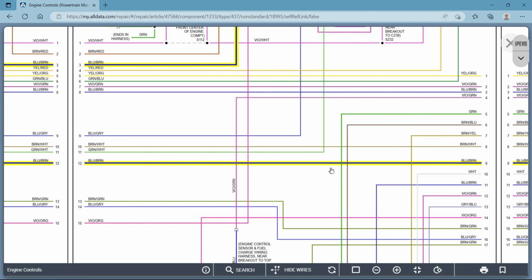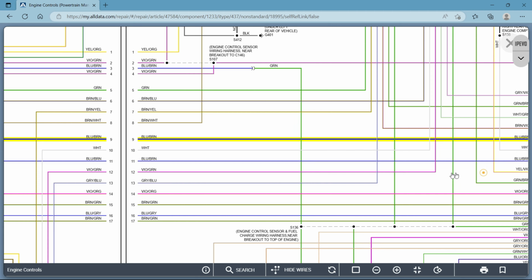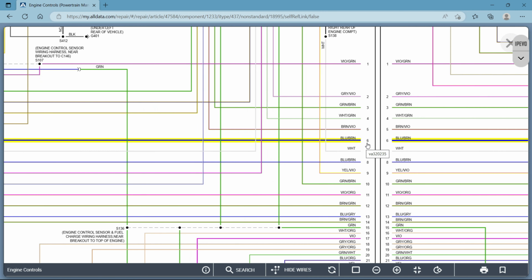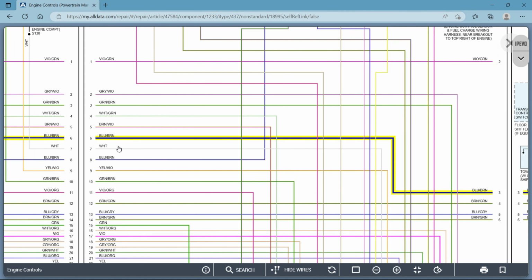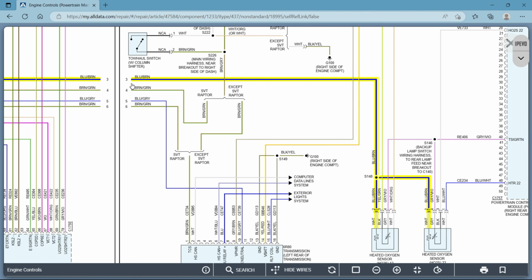So now if you follow that wire along to the right side of page 2, you'll notice there's still a number there, but you'll notice it's not number 12. That's fine. All you do is go to your next page in line and find your number 9. It corresponds with the number before. Same thing, scroll to that side of the page and you'll see it's number 6 and so on and so forth, okay? And by the time you get to your last page, so this is probably a 6-page thing, but nonetheless, you'll go from number 6 to a number 3. Now your last page, you go to number 3, and you can see it'll take you down and feed your oxygen sensors. Okay? That's all.